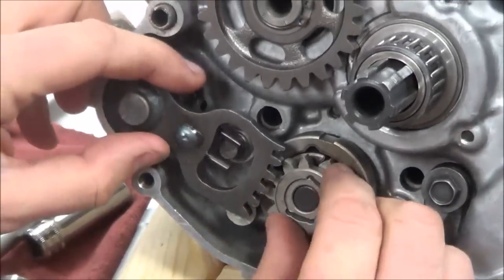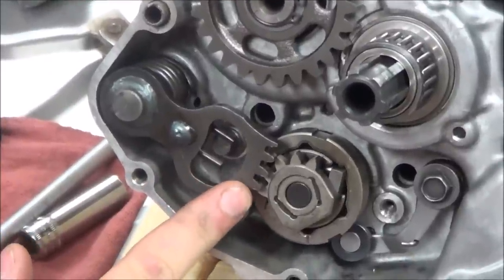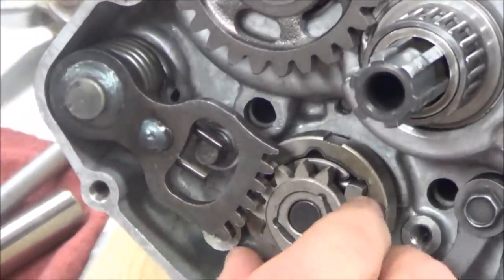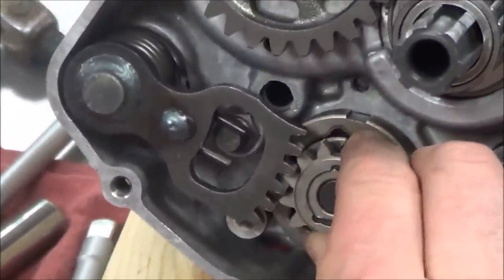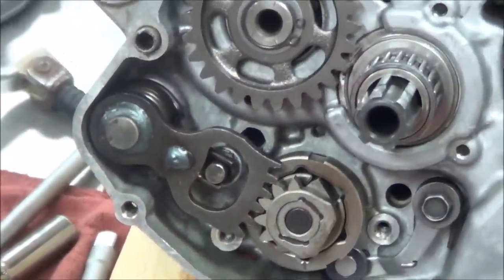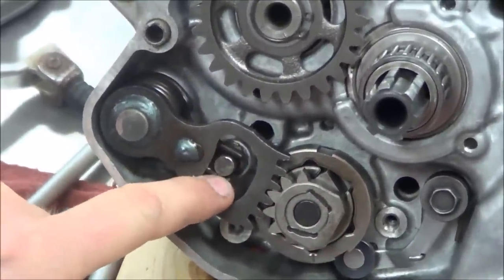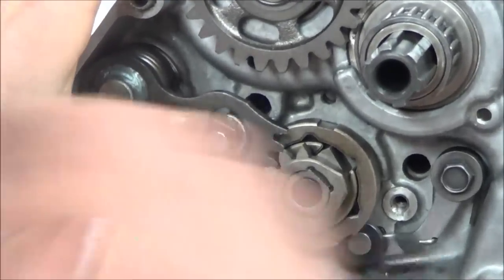I don't want to do this wrong, because when I go to upshift or downshift at some point I'm not grabbing all the teeth — or it might just give you one turn out of it. When I fully assemble this you'll see a real equal amount of teeth. Did you see how that spring internally went around that pin, just like from our disassembly?